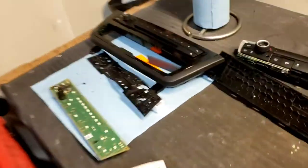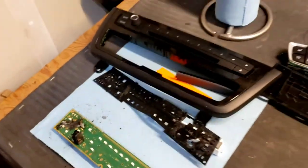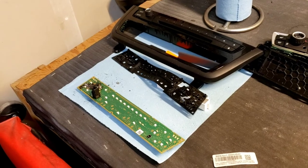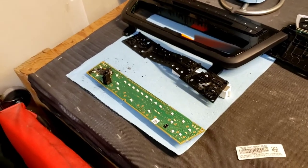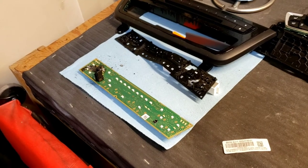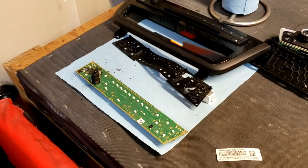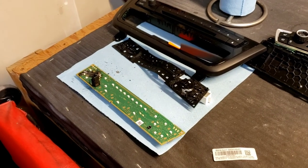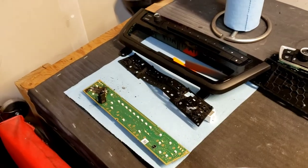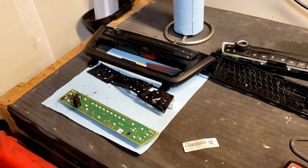To review what happened: fuse F10 kept getting blown because the circuit board was destroyed. What happened is the wipers would stay on, blinkers wouldn't work, cruise control wouldn't work, multi-function switch issues, and so forth. We replaced the bad circuit board. Got a new used one from eBay for $120 compared to $2,400-2,500 from the dealer. The one from eBay programmed and coded fine but wasn't working as advertised, so we sent it back and got another used one for $175. Put it in — there were two codes, no communication with HVAC and no communication with radio — programmed and coded it, and everything is good to go. That is the fix for the 2015 BMW 428i.